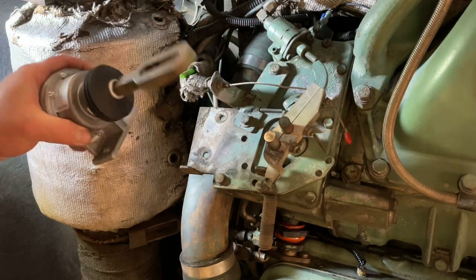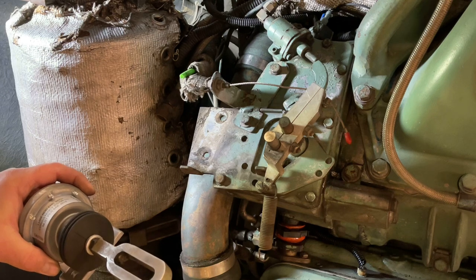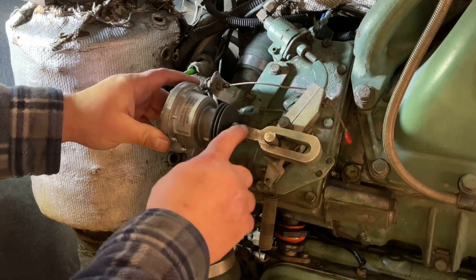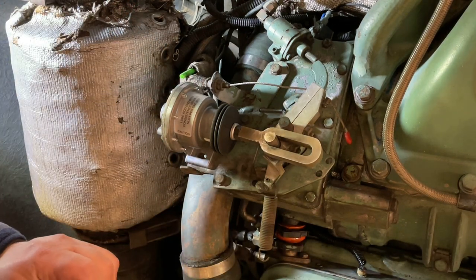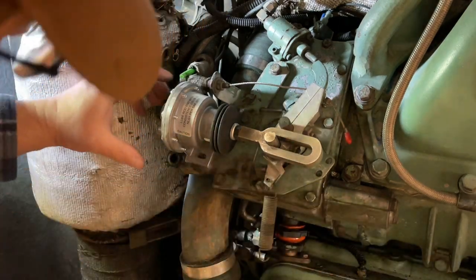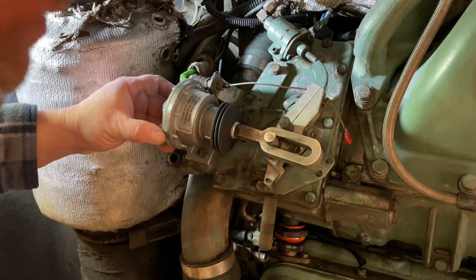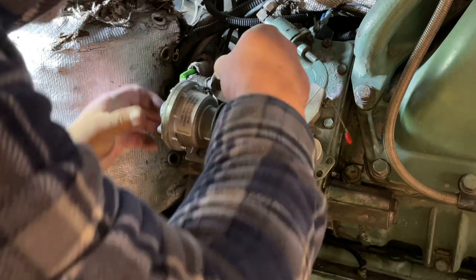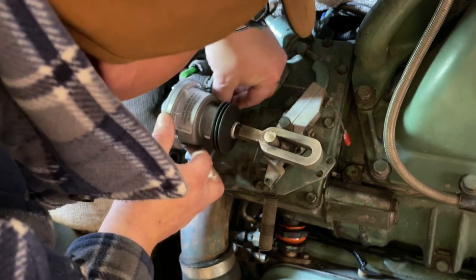So I'm making the final adjustments here on the governor. This is the idle position here. And I've just about got this bottomed out on the shaft, and I've got to see, these screw holes, these slots, they appear to be just about maxed out on their adjustment back, which would potentially indicate, oh, okay, yeah, that's fine, right there. That one fits in. Let me see if the other one fits in there. Another screw fits in the slot here, hopefully, yep.